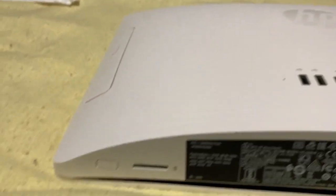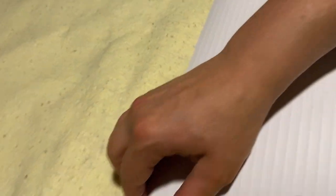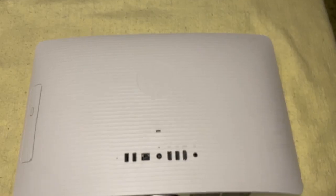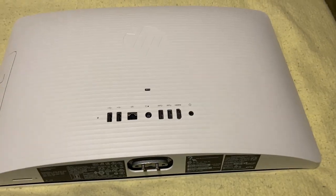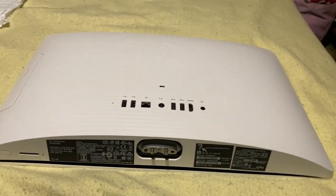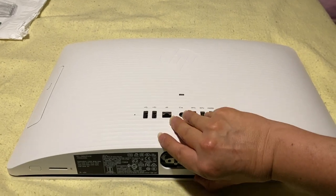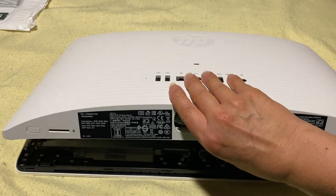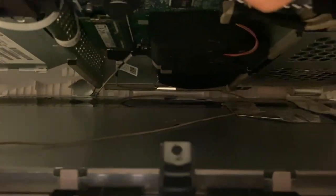It's completely separated. The back of the all-in-one is completely separated from the front all the way around, and you'll be able to feel that gap all the way. Remember: always the top first, then the left, then the right. Now we're going to very, very slowly and delicately lift up the back. Make sure you're also on a very soft surface — I'm actually doing this on a bed with a blanket. There are wires inside that are attached from the front to the back and cabling, and you don't want to separate that.